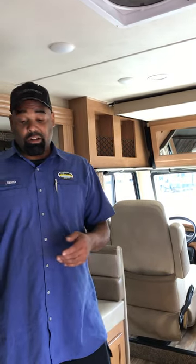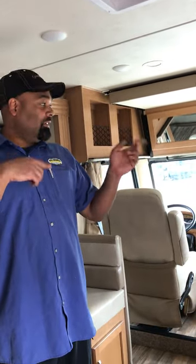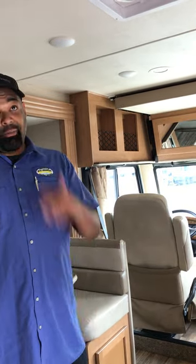You'll come inside. You can either dump a bucket of water or hold the pedal down on the toilet. Put your chemical down as the water's going down, so you're putting about 2 minutes' worth of water down the toilet with your chemical. Now, as you're driving home, it's sloshing around back and forth. That's cleaning that tank out, so you don't have anything solid in there. That's the best way of doing it, and that'll make those sensors last.